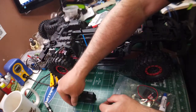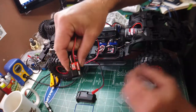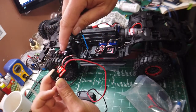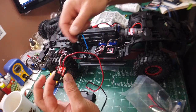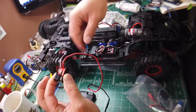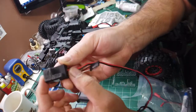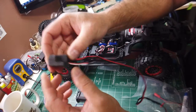There's a new O-ring, so if you damage the existing O-ring from the receiver box, you've got that. There is the BEC — there's a little receiver plug that goes into your receiver to feed power, and your ESC comes in and fits in there to pass through your ESC signals. But inside there must be a break, a cutoff, that will disconnect the BEC power from your ESC and then feed the BEC power from this unit into your receiver and your power cord. There is a piece of foam that I already installed here — it's a little L-shaped piece of foam, and on the bottom of the BEC there is a shiny footprint where it shows you where exactly to stick the foam. I've already stuck that on.